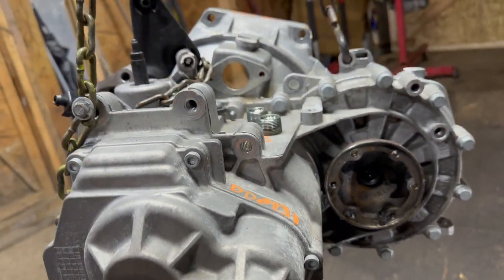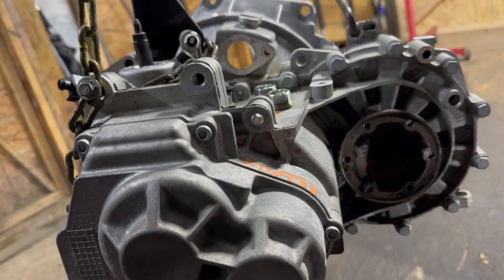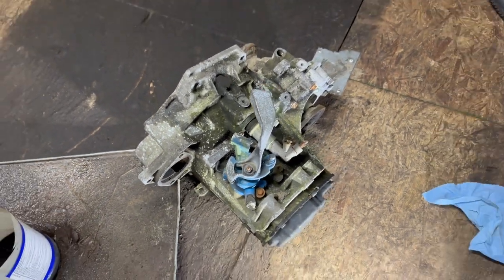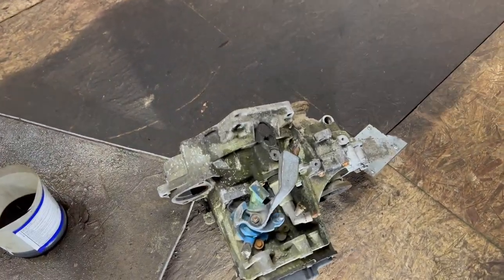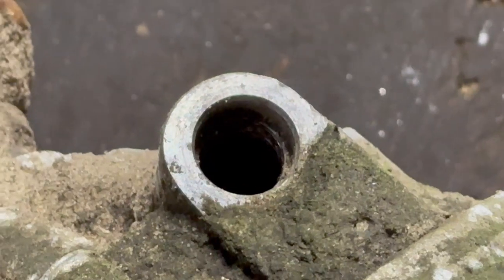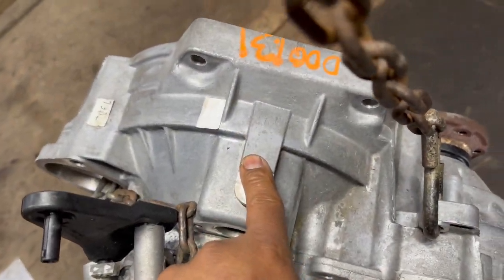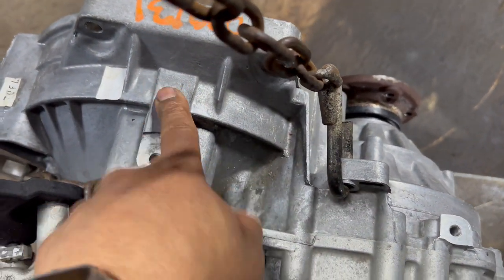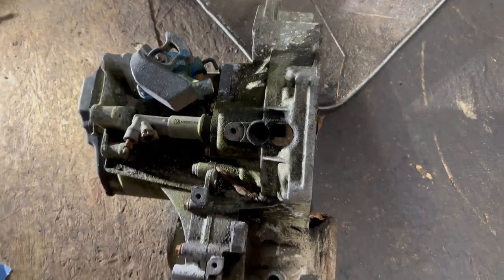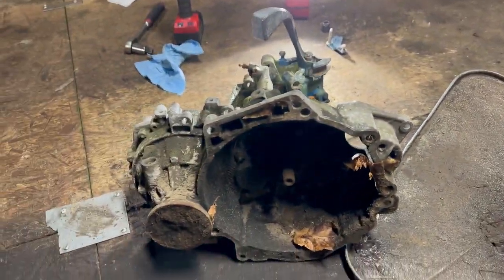I know I have something like that engine code. So I'm gonna transfer into my 02J case. I know this one looks very, very rough. But what we're looking for is top dead center for the flywheel and the speed sensor hole. The new one doesn't come with the speed sensor hole and the top dead center. We probably can cut here and get the top dead center, but it's a little bit out of line. But we're gonna put the gut from this transmission inside of that.